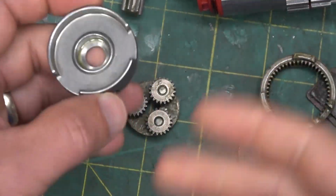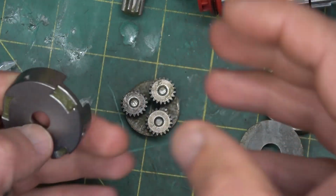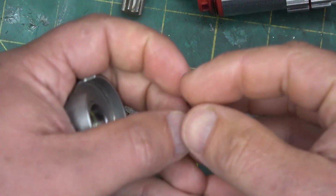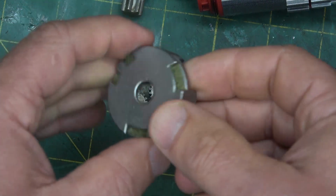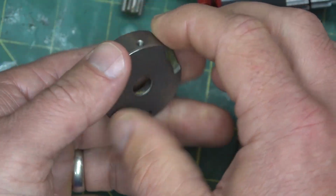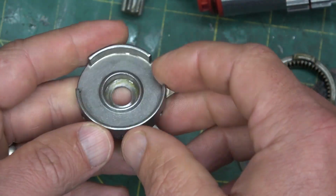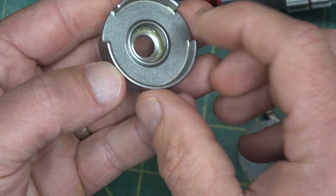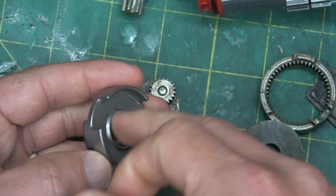Certain processes lend themselves to certain things, and you take a sintered bunch of material, you green press it, you cook it off, and then you sinter it together. It's going to shrink. So it's real tough to get that dimensionally accurate enough for a bearing bore, as witnessed by the fact that they had to go in here and further process it on a lathe.